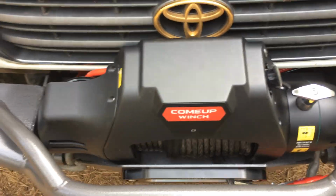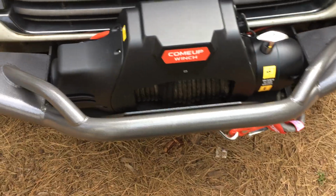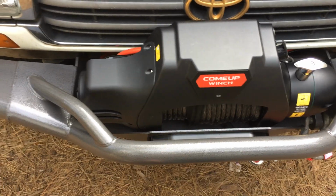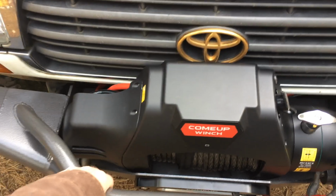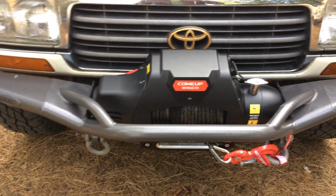It gives you more time to assemble stuff, because if I use the blue or the red, I wouldn't use the red on these. I might want to work on this winch and I need to take it out. I don't, that would be crazy. How would I get a torch in there? But I think I've seen blue, once the blue thread locker cracks, it comes loose, and it doesn't have any holding power.